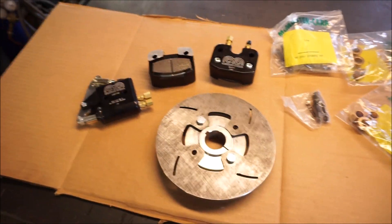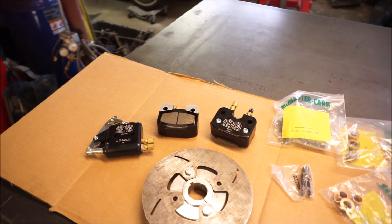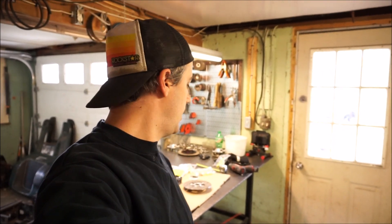If you're new to this, you may not be impressed by the stopping power. They make bigger rotors — 10-inch rotors — and you can also put two calipers on the 10-inch rotor. We're running bigger tires, at minimum 16-inch in USLMRA for a prepared class, and they're heavier, so you have more leverage on the brakes. On a hard clay track you're probably not going to lock the brakes up. But on a looser dirt track, under heavy braking I can do a controlled slide going into the turn — slide the rear end just enough without locking it up.